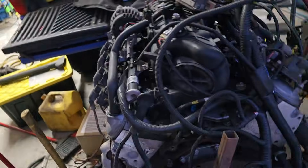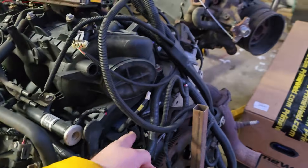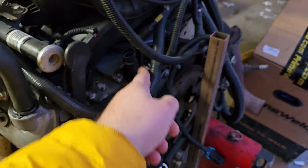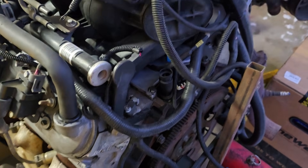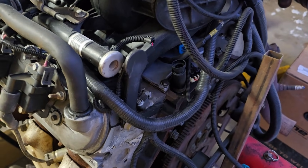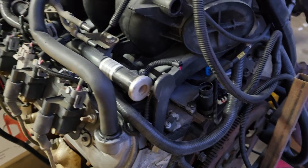Back to the LS engine — that's your oil port. This is the rear of the intake, right down there. You pull this out; the PCM does not need it. I believe that's an M14 fitting, but I'll put the exact size up on the screen. You adapt it to your oil pressure sending unit size.